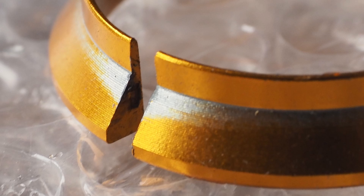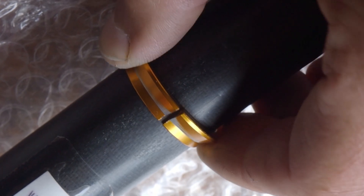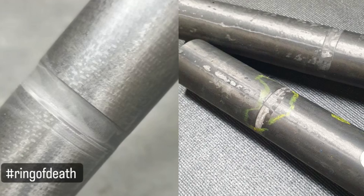Visual inspection suggests it's wear. There's also some telltale debris left on the headset bearing collar. In addition, some of the anodizing on the collar has worn off, which indicates there's also been some wear between the collar and the bearing. When the parts start to wear, the grip of the collar on the steerer will reduce, allowing even more movement and hence more wear. The wear is therefore self-reinforcing and will accumulate over time, which possibly accounts for some of the severe damage seen in internet photos.